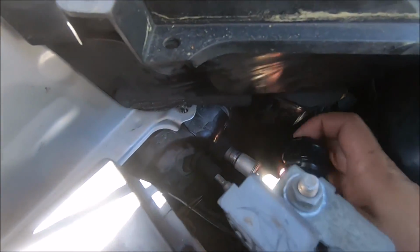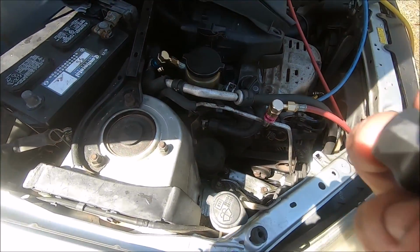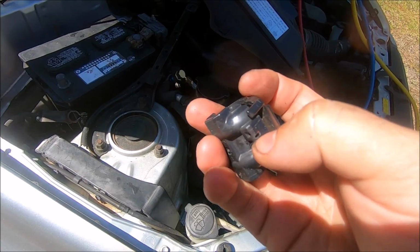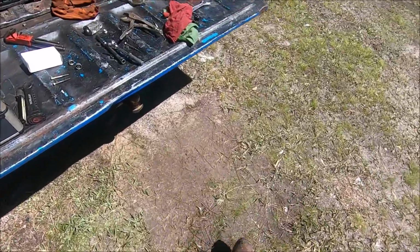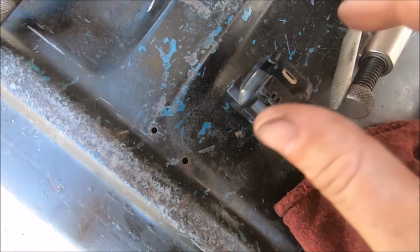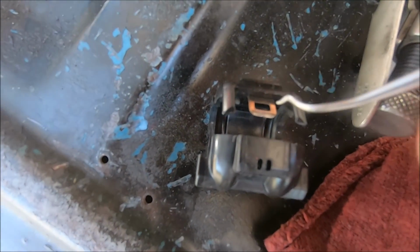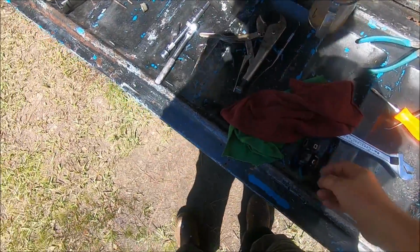So to disconnect those clips I was talking about, you go down in here and there's one on each of the lines. They look like this, and I'm sure I've said this before, but they clamp together to clamp the line on. To disconnect them, you can just push a probe down through this line and push it hard enough and it'll kind of spring apart. For the Toyota, there's a special tool with a 2-pin prong, but you don't need two pins. You can just press really hard on one because it's still one metal clip, unless it's been modified, and you're pressing the whole thing down. That's all you need to do, because down in there's a tab that it locks onto. So that is all you're springing apart.